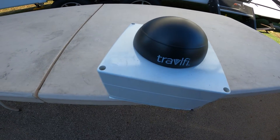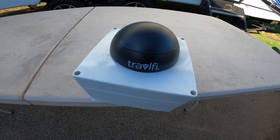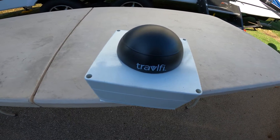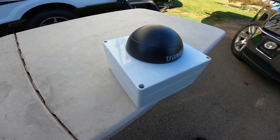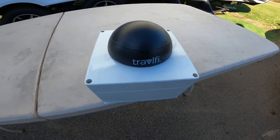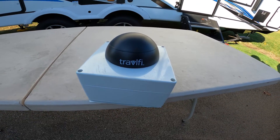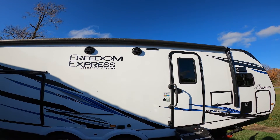Here's what the piece looks like. I'll be hooking this up on top of another box I have — this is going to go on the roof. This unit does come with a mounting plate that screws flat to the roof, but because I have another project down the road that I need this entry box for, we will be mounting it on top of this. It has 3M tape — a sealant and adhesive that holds it down. On the bottom side of the antenna there's a large stainless steel nut and a flat washer that help pin it down and make a watertight connection.